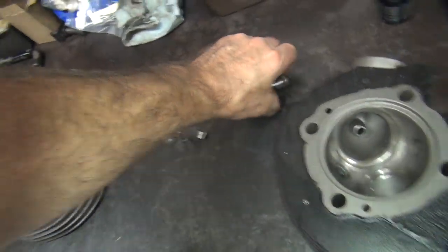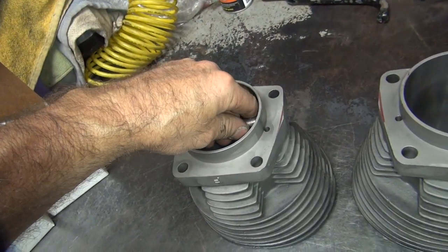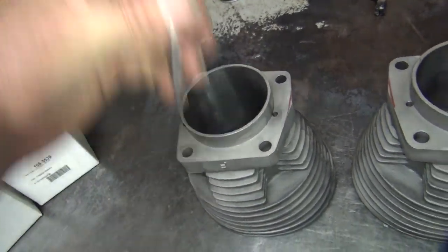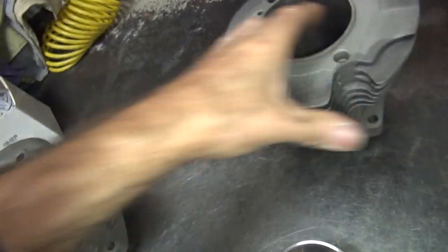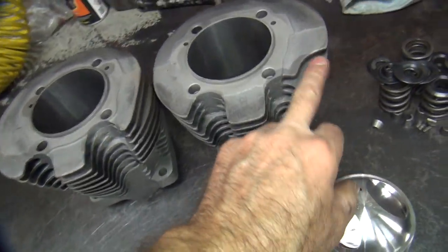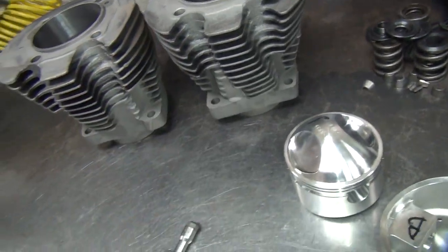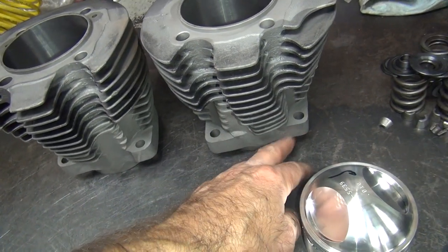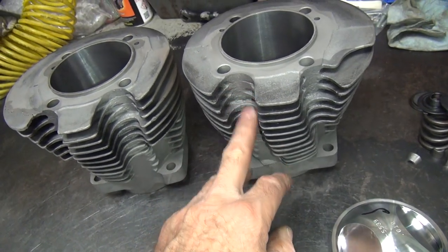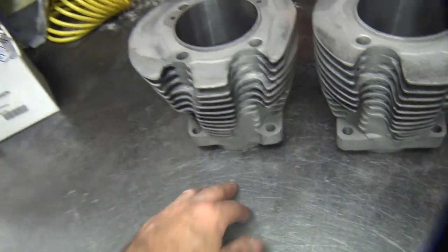All I've got to do now is figure out which cylinder is which. I think the rear one's going to be the big one. So we take the mic — that one goes in there, this does not fit, so this would be the small one. The way Sportster cylinders trim on the part — usually this is notched out for the exhaust system. If you look at the valve relief, the push rods are cut on the intake because they're closer than the exhaust. You can see how it's cut a little closer here but not in the base. This one you can definitely see they cut the base out. So this is the rear.